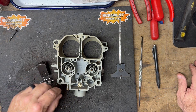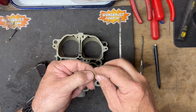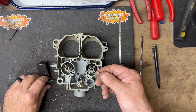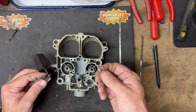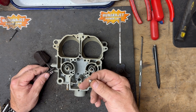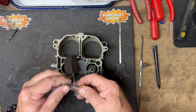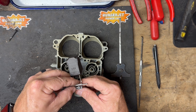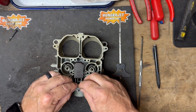Now the big question — this little hanger for the needle: do we need that? The answer is no, you don't have to use the hanger for the needle. In the old days, fuels would gum up, so you wanted to lift the needle out of the seat because dried fuel would stick the needle in place. If you do use the hanger, you put it through here — there are holes on most floats on each side, but you do not put the hanger through the holes; you just hang it over the front end, then drop it into place.